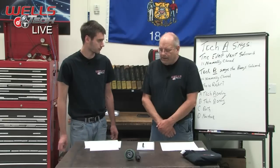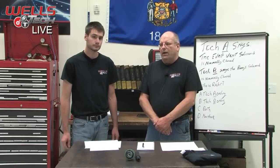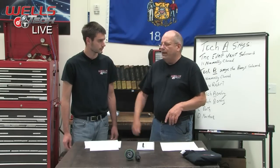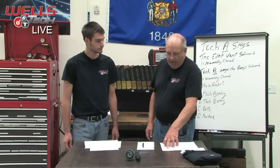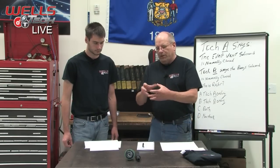All right. Let's talk about that check valve again. Let's get back to that rollover ball. That's a real important part when you go through the testing on one of these. Actually, we have a video that we put out years ago on that, so we'll put a link to that down there. That was on that Grand Am, right? And it turned out the filler neck was leaking, in between where the insert is.